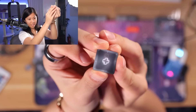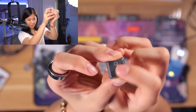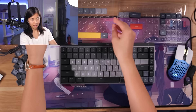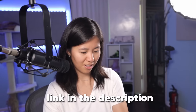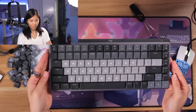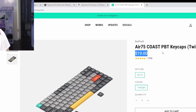The original keycaps are quite thin - you can see the shine-through happening with the Q key. They are cross-shaped and look just like Keychron's keycaps, not much difference other than the font. Very thin, very grimy - not a huge fan. I'm going to change the alphas and the arrows. If you change the numbers using 60% keycaps, the sub-legends won't be the right symbols. I'll link the 75 set below so it's more accurate. You can't change all keycaps since they're not the same size, but done like this it doesn't look too different - no shine-through but it's white so it's easily visible.